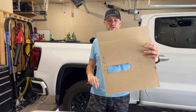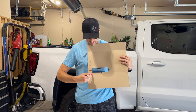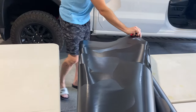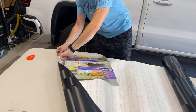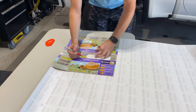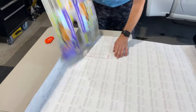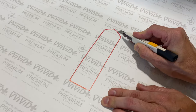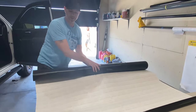I made a template so I know where the shark fin is going to be. The shark fin is actually a little bigger than the template, but I'll pre-cut a hole to help me get the orientation correct. The vinyl is going to go on this way, so my template goes like this — we trace the hole on this side, square it up, and cut within the line. Then I'll roll it up, get up there, and do a test fit.